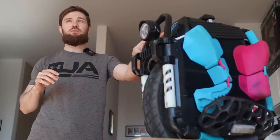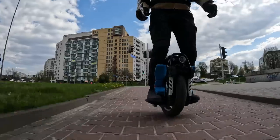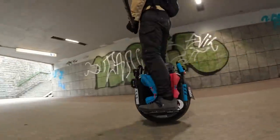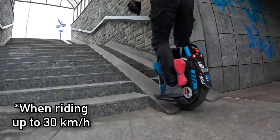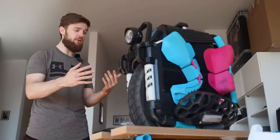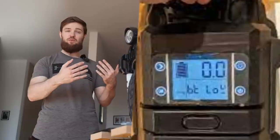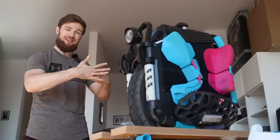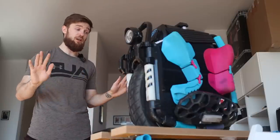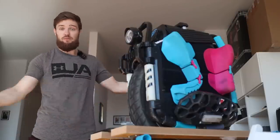With this wheel I pretty much never take the charger with me, whereas with the Veteran Sherman I was sometimes concerned. I think going over 100 km — like 120 or 130 — is the comfortable top limit for daily riding, though 150–200 km is also possible if you just take a charger just in case. Additionally, the shell has been improved — the BMS could get damaged on the original Sherman when the wheel fell on its side, as the thin shell pressed against electronic components. That's no longer the case on the Sherman Max, which has structural reinforcements inside.